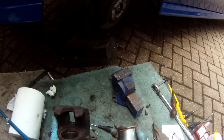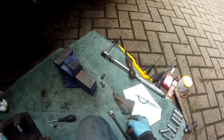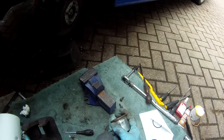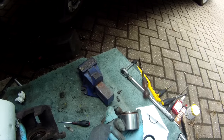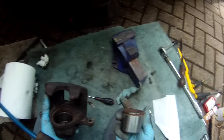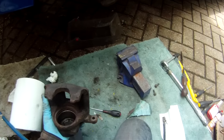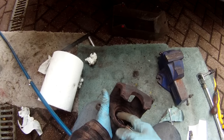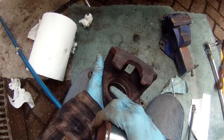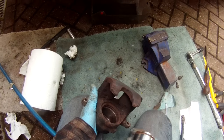When you've cleaned up your piston, if you're going to try and reuse it — rust marks you could try and sand away, sand smooth with a bit of 1200 wet and dry paper, which is what I've done. I don't know how long it'll last and I can't really recommend this on the video, but the rust isn't too deep so it'll probably be alright. Use an airline to blow out all the little bits of dust and rust. Check that your piston fits in neatly — it didn't fit at first because there was a bit of rust around the top edge, so I had to scrape that off with a little screwdriver, and also use a screwdriver to go into all the recessed parts to scrape out all the rust.